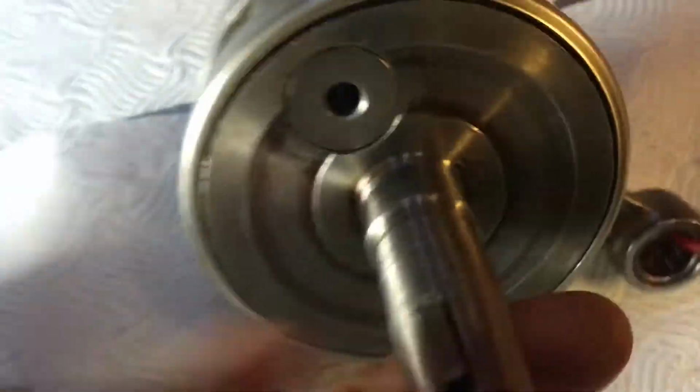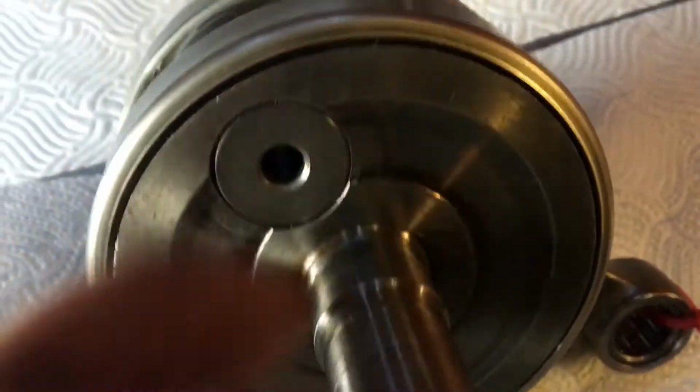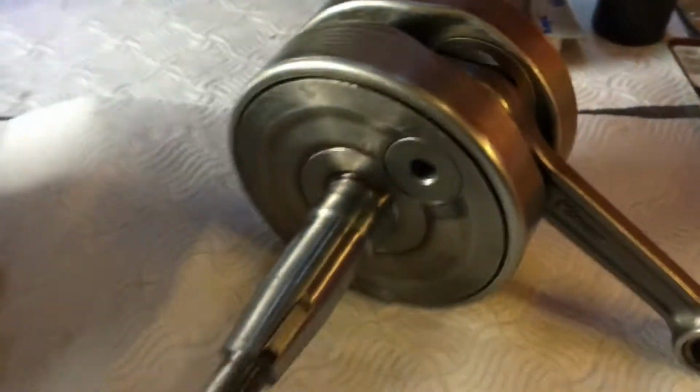The guys who are trying to build these, and I have seen it with my own eyes, are actually hitting these with copper hammers and smashing all this tin coating in, shall we say. I mean, it's a solid steel crank on the inside with a tin coating machined on it. I mean, it's just daft. The daftest thing Honda's ever done. But no, we do a pretty good job of them and they can be done.